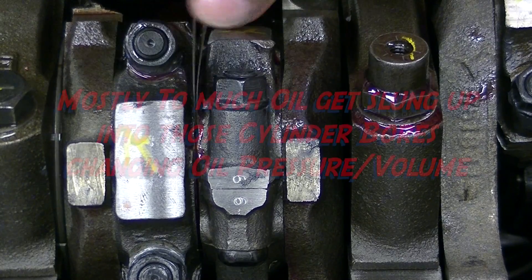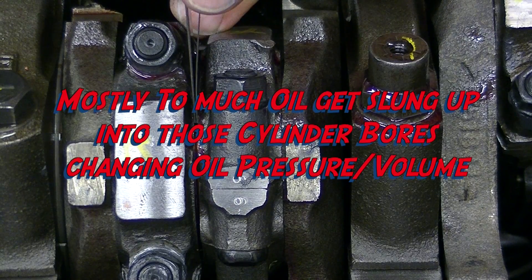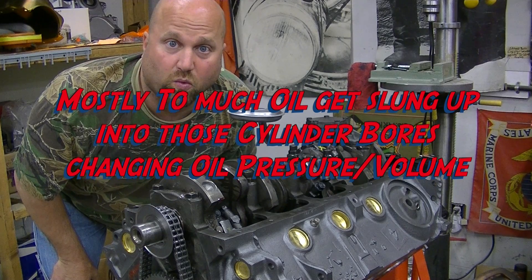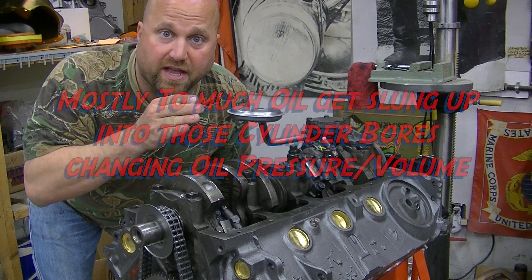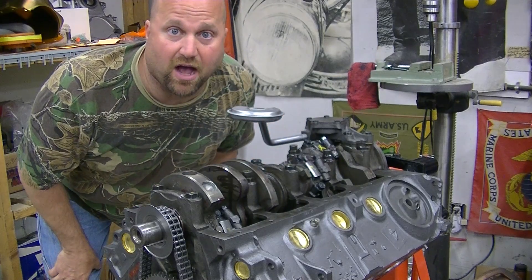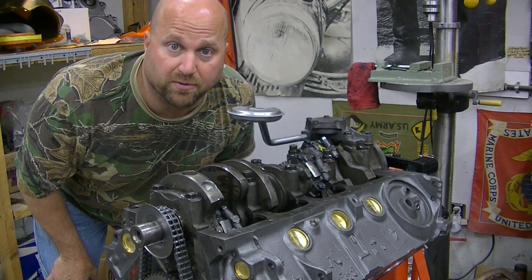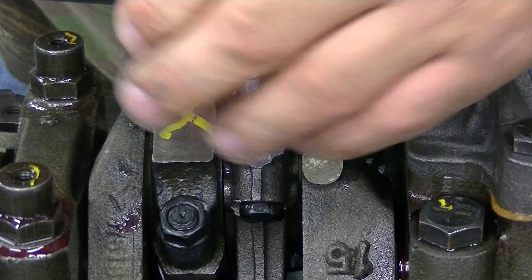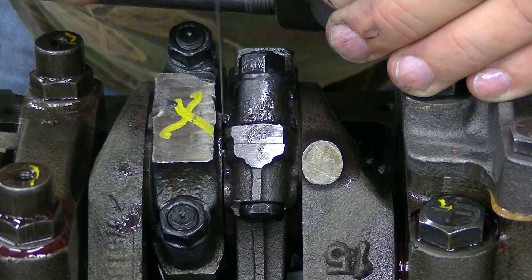Both of them like that — that's a 46 thousandths gap. That's going to cause the bearings to wear out unevenly. The number 7 and 8 is 28 thousandths — totally unacceptable as well. 28 thousandths, and we'll fit that in, and it's in.